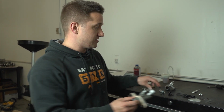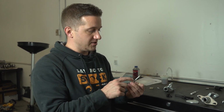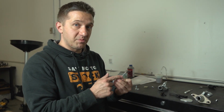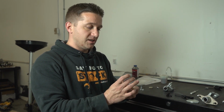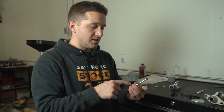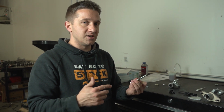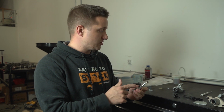We have a Honda guy here that used to be a Honda tech, and he said some of the problems of the 8th and 9th gens were the plunger off of the pedal was a little bit too short, so you put a new clutch in and it wouldn't have the proper length in order to disengage it. But we didn't have that problem with this one. After we've done either clutch, it does have a full sweep on the pedal. So I don't think this is too short. So I think maybe our only problem was the slave cylinder.